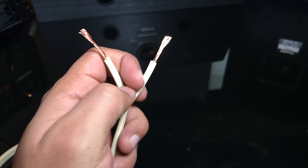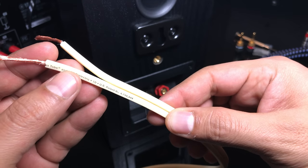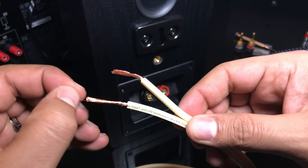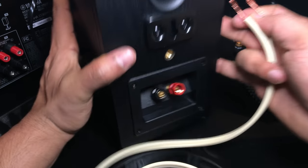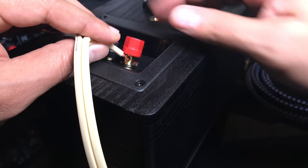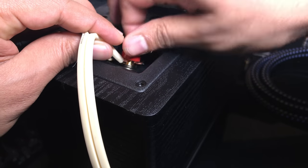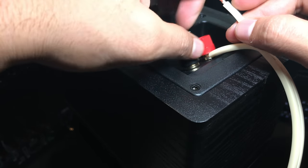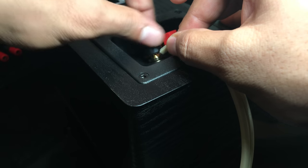I do this because I don't want to spend the $15 to $20 on a wire stripper, but if you want to use one go ahead. When connecting these we need to make sure one's positive and one's negative — just choose one and go with it. Most cables have writing or a little line on one of the wires, and that can be your plus or your minus. Unscrew the binding post on the back of this SVS Prime Satellite speaker, insert the wire, tighten it up. When tightening the binding posts, make sure there's no rubber underneath — you want just the copper and the metal of the speaker in contact.